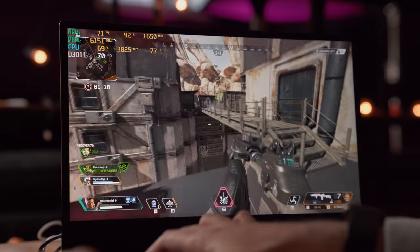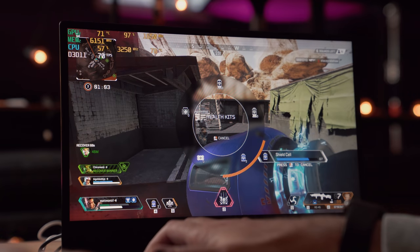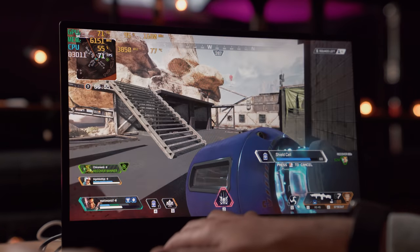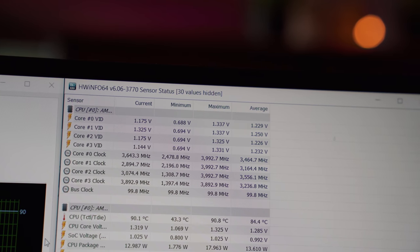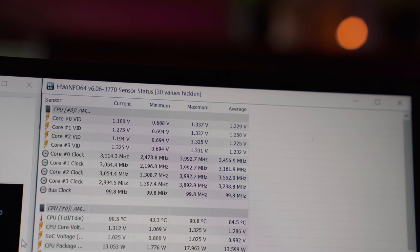Because this is using an AMD CPU — the 3750H — you're probably wondering how it stacks up to Intel processors. The short answer is it's comparable to the i5-8300H or 9300H. The big difference though is that this one is more efficient and runs cooler. It's 12 nanometers compared to 14, with a TDP of only 35W, so the overall load is handled much better. When gaming, this thing never passes 75 degrees Celsius — it's so well cooled. Even running hardcore benchmarks it only reaches 90 degrees and it's still boosting to its full potential. Intel laptops with equivalent CPUs would have to thermal throttle or reduce clock speeds down to 2.6 or 2.8 GHz.